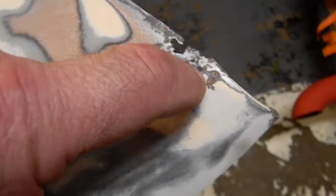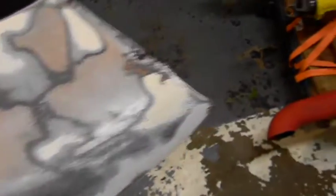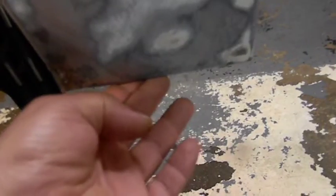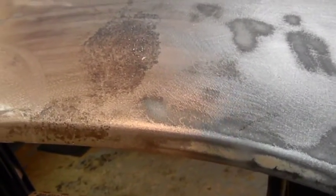For some reason, I got a little right here. The molding covers it to right here. That's why I never saw it. Okay, I probably saw this and didn't notice. That was no big deal either. He took the trim off. You got perforation right through here, as you can see. We got a little perforation on the bottom. The backside lip is both flat, sits on top of the rocker. It's actually good. This roughness right here we always saw underneath the paint, because the paint had come off and the last guy touched it up with a brush. So I always knew that was there.